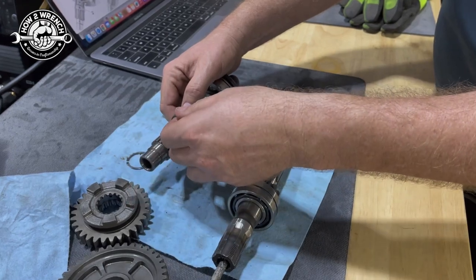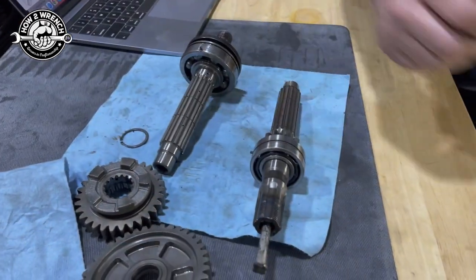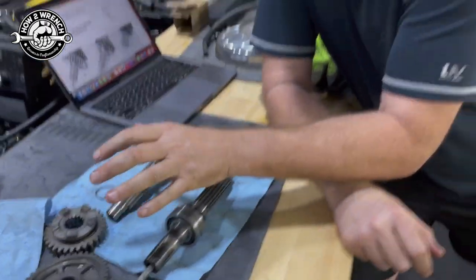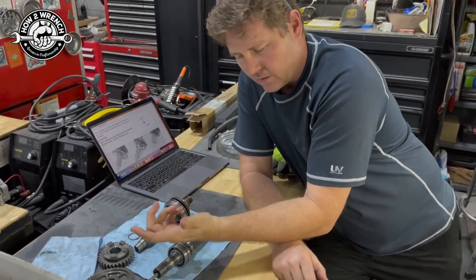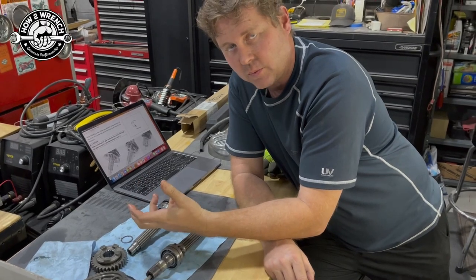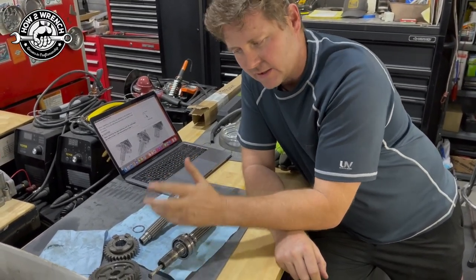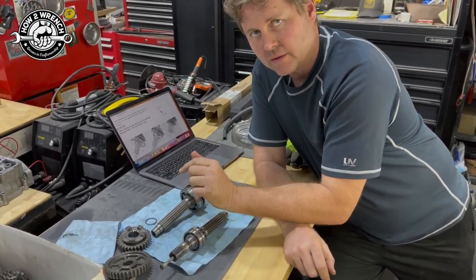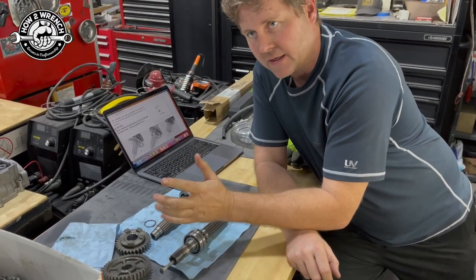There's clearances in here and it's going to eventually get around there, but I was telling Kenny here that this is where a lot of people get lucky with motorcycles, ATVs, power sports transmissions. If they don't get rode hard enough or abused, they might not ever see the problem, or not for miles to come. But if it gets used even slightly hard, and we need that oil there, that oil's demanded there, we are going to have a problem. So that's one thing to think about.